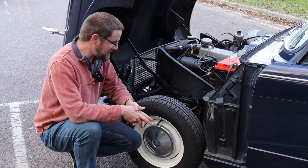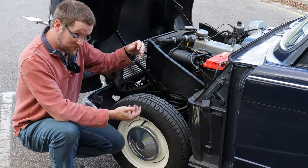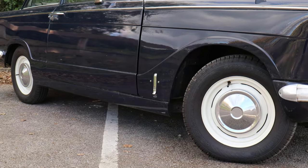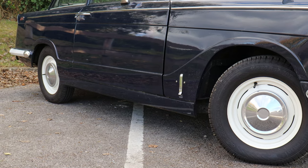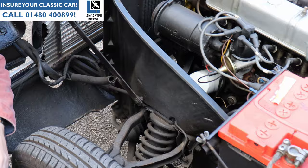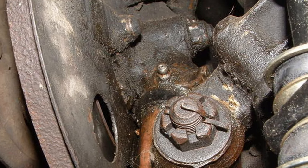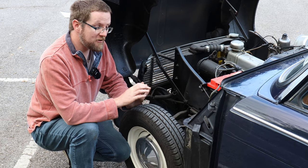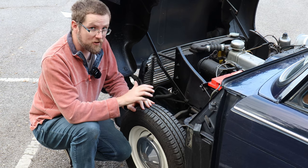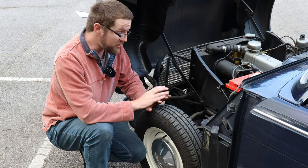The Herald is very modern at the front suspension and a little archaic at the rear. The front has twin wishbone coil springs with dampers up inside the coil — the suspension uprights were actually used almost unchanged by Lotus. Check that springs aren't cracked or sagging, dampers aren't leaking, and do the bounce test. One important thing: the trunnions need to be very regularly lubricated to avoid wearing or seizing — if they seize they can snap and the wheel collapses. Triumph's official line is they must be lubricated with EP90 gear oil, not grease, as grease doesn't flow into the threads properly. Check they've been oiled, not greased.